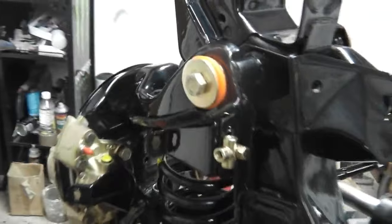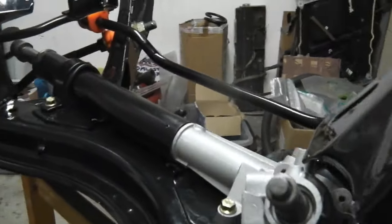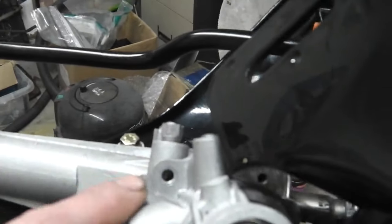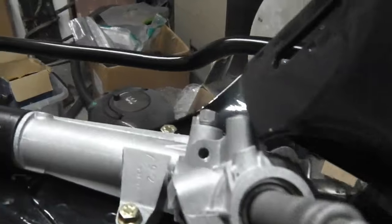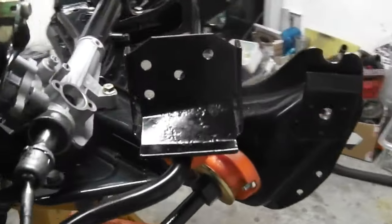So that's it for this little section. A couple of little things just to put on the clip, then we'll start on the steering rack. We'll get those tubes remade, and we'll get the gaskets and everything fitted back on, and put that back together and grease that up, put the boots on it, and we're okay. We'll test that, pressure test that steering rack.